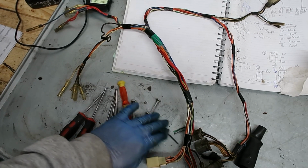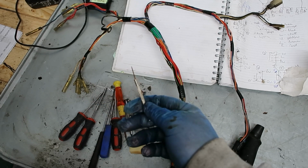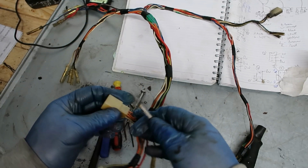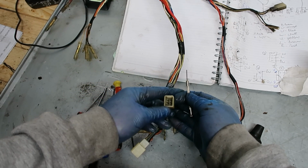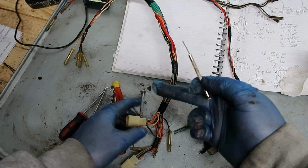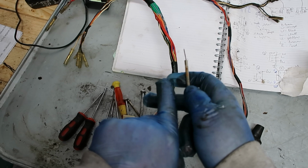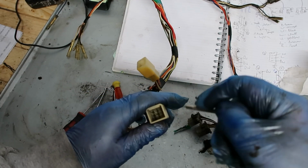So there's loads of different things you can use to pull the plugs out. To be honest with you, I always use this thing. Always frightens me when I can't find it, because I do use it a lot for this. I'm sure, absolutely sure, there's a proper tool. Don't know whether you can see that, but if you look into it, you'll see that the pin sits and there's a small hole gap above it, and it's into that gap that the tang has been fitted. So what we need to do is to push that tang down.